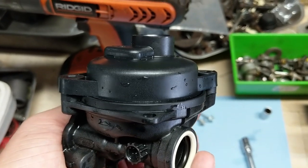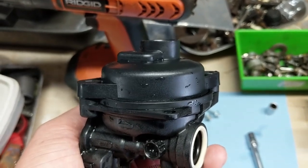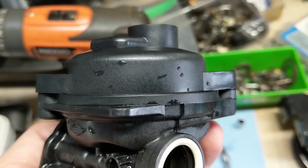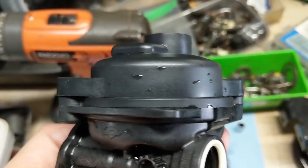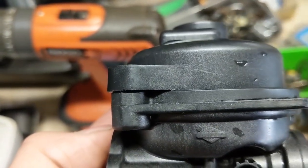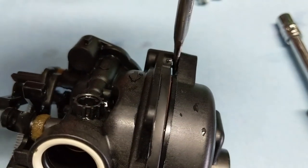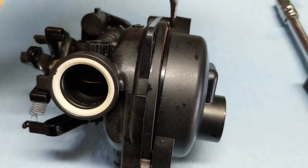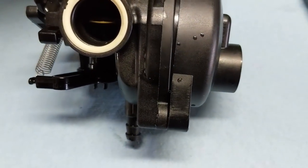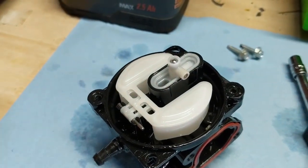Because they make such a tight seal around the sediment bowl, I normally like to come in with a small flat-head slotted screwdriver and just pry up in that little corner. You don't want to go much because it is a plastic carburetor. Go to the other side and do that as well, and with the bowl loose we can go ahead and remove it.